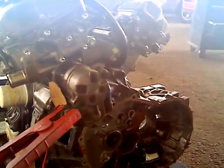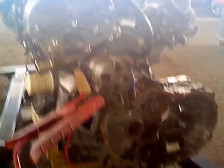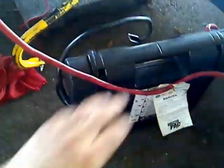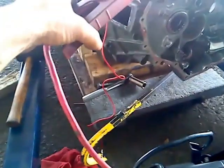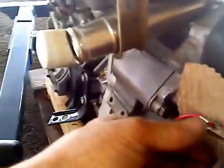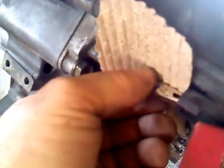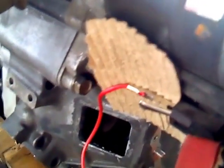So how am I going to get this to crank? I got a power pack. I put the positive of the power pack on the positive pole of the starter. Then I take this wire with an alligator clip and put it onto the solenoid connector. I put a little cardboard behind it just to insulate it so it doesn't come in contact with anything.